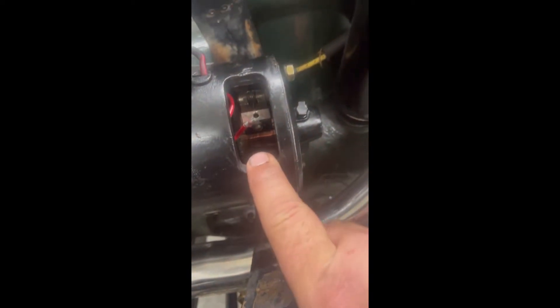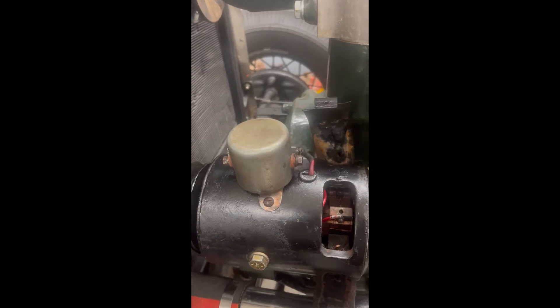So there's all the new brushes and there's the new field coil wire. We are way up there in the adjustment now — that's good for about 4 to 5 amps at high idle or high speed. We were down here before, now we're up here, so it's a huge difference in the adjustment. Whenever you start it up it probably takes a second, but once the armature builds enough field voltage it'll just click. I had mine just where the previous adjustment was and was getting 4 amps before, but leaving it where it was down there I was getting 15 to 16 amps now.